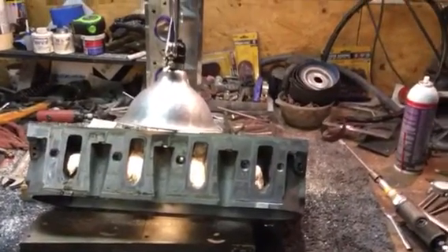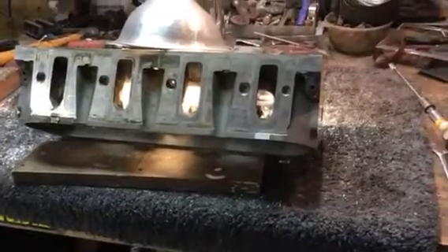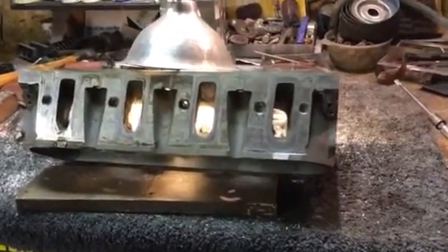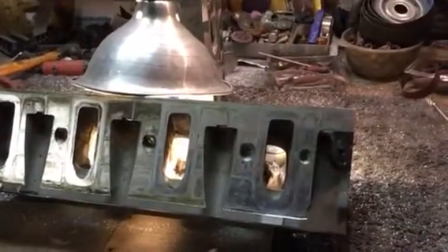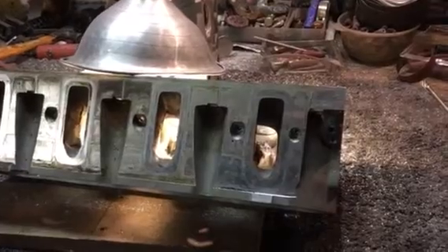LS 241 heads, number two. In process, I wanted to touch base on the little boss that's inside the intake runner on these LS heads. Basically, what would normally be a stud is an intake rocker bolt hole - where that threads into the cylinder head casting puts a big bump down inside the port. If you look inside this left port, there's a huge bump on the bottom left. Keep in mind this head is upside down, but that bump at the bottom is basically a reinforcement for that intake rocker arm bolt.